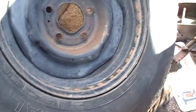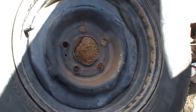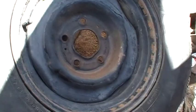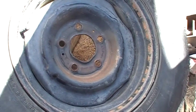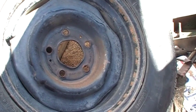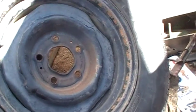Filling the tire with water was an old derby trick, because simple physics: air compresses, water does not. And this is a bone stock class. You know, you have to run car tires, or DOT approved car tires, truck tires. So this was my alternative. Not allowed to double stuff them, so I went with the water idea.